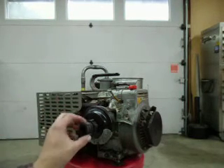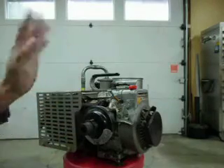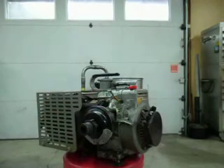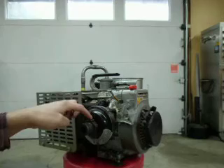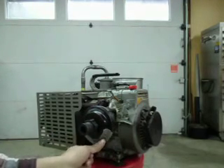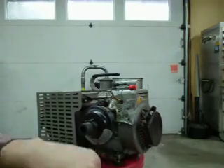What I've done is added a male cam lock fitting. If you looked at my earlier video about my plumbing, that's why I put that on there. It doesn't have to be — you could put a screw-in hose barb in here if you wanted to, and that would work fine, with the hose permanently attached. I just wanted it removable in case I wanted to go from generator to chipper to whatever. This is obviously the carburetor and air filter housing. All I did was cut a hole big enough for this to fit in and sealed it with a couple of O-rings on each side. These were breather holes, and I just took a couple chunks of duct tape and plugged those holes up so that the only oxygen it can receive is from my ball valve.